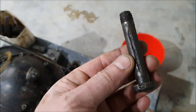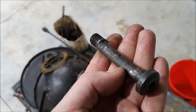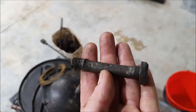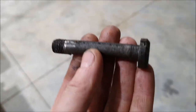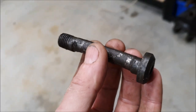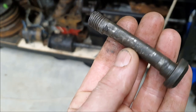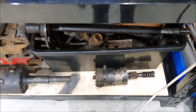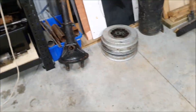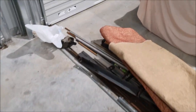This is one of the reasons you don't really use a lot of these old parts — this is one of the shackle pins and you can see how much wear is in it; it's just so worn out. And that's why, even if you get a parts car like this, there's a good chance that if it's an original car, a lot of the original parts are going to be so worn out you can't use them anyway. So I've got new ones of those.